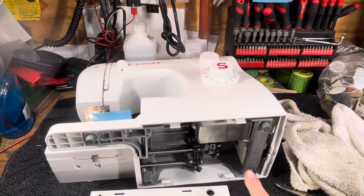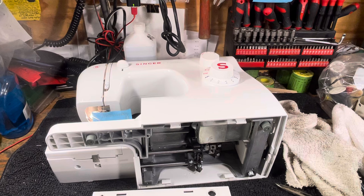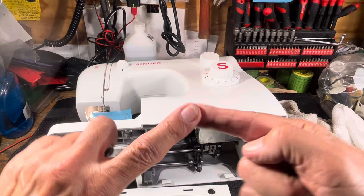It's a fractional horsepower motor. It's a good one. And if you take this off and you see things that are hinged, swing back and forth, anything that is hinged or rotates or pivots or slides, give it a drop. All these little bearings, just a drop, just a drop, just a drop. Anything that rotates, pivots, hinges or slides, even over in your take-up area over here.